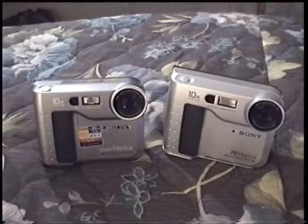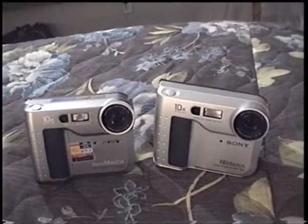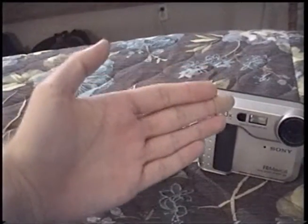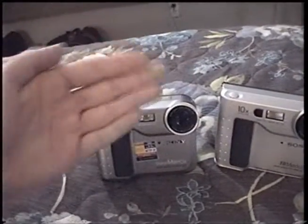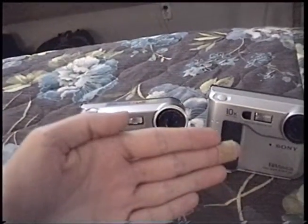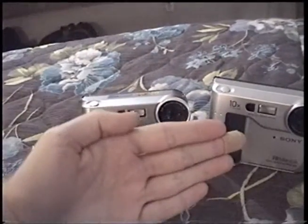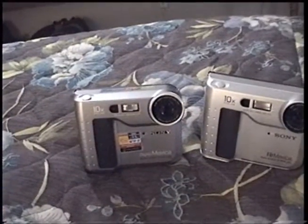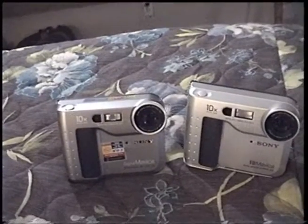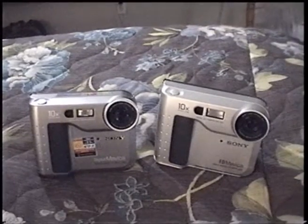When you take it in frame mode and you take the whole image, it's better quality because you have more scan lines, but if you're taking a picture of something that's fast moving, the picture will look like there's double vision. Like if I took a picture of my hand moving really fast like this, the picture will show my hand here and my hand here because my hand's here in one field and my hand's here in the other field. So you get a higher quality picture, but taking a picture of anything that's moving fast enough looked terrible. So this was with the first generation Mavica cameras. They actually took an interlaced image.